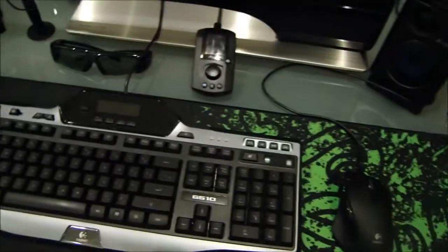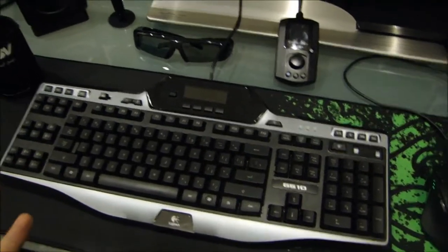There's a quick preview of my build. So what you need connected before first boot is your mouse, your keyboard, and your monitor of course. Connect your monitor with a DVI or HDMI cord — not VGA. Why would you want VGA if you're putting in an extreme build?